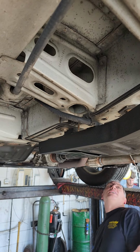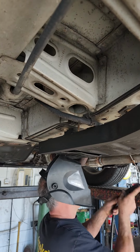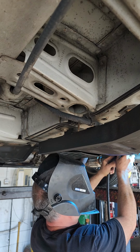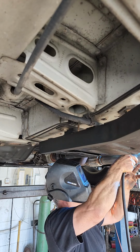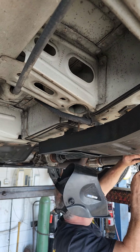So that's welded in, that's welded in. We're gonna finish weld this, and then we're gonna leak check our work. And by going 1 o'clock and then clockwise here, I know that I have what I need to weld the other side without really seeing.